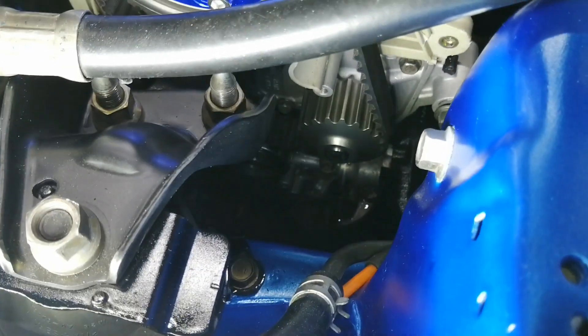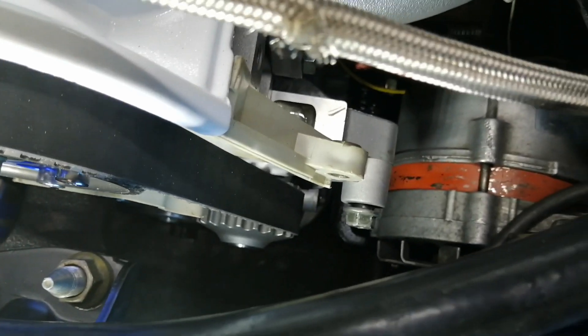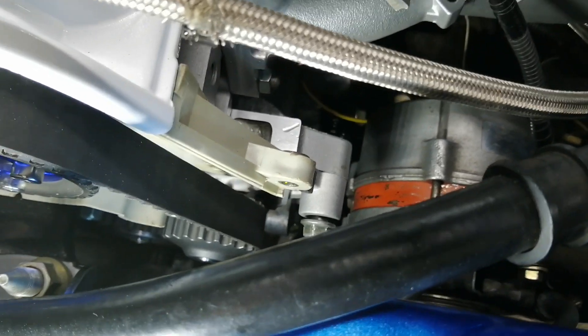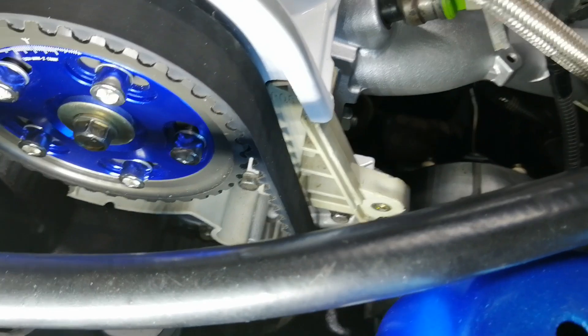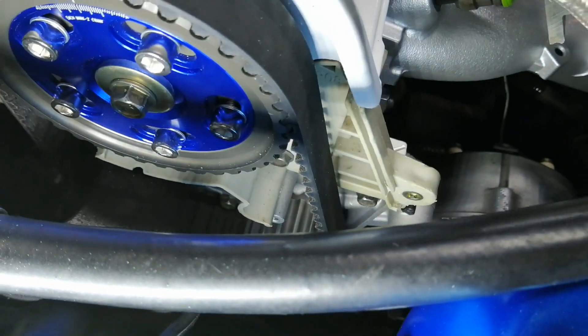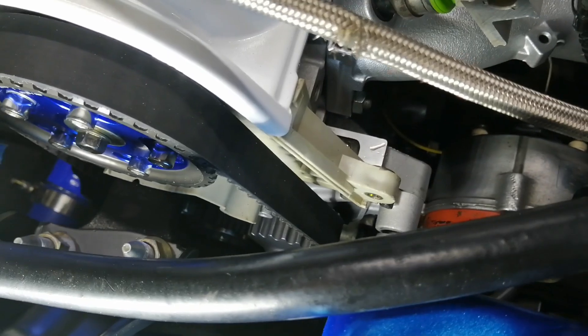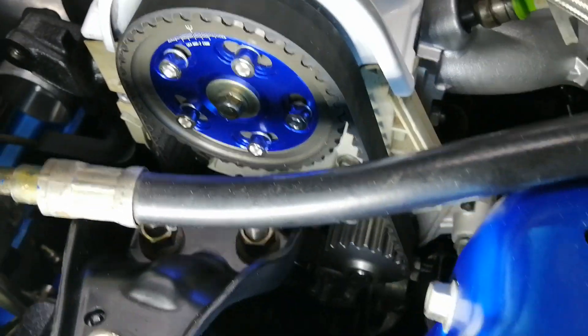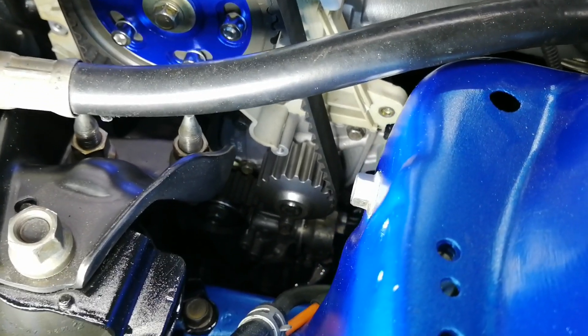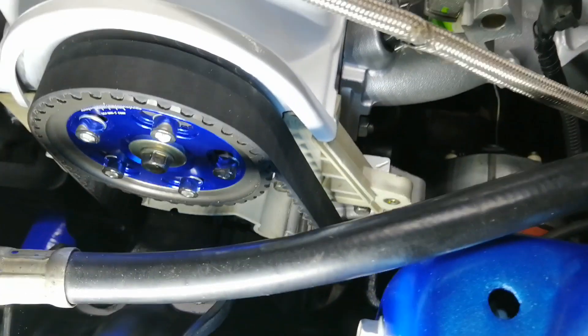The pump is on. I thought I'd use a big bolt to push it in but it was flexing, so I just used the normal bolt you can see there, and it actually worked — as I was turning it, it forced the guide pin into the block. The pump is fully on. Now I'm just going to put water in it and see if there are any obvious leaks.